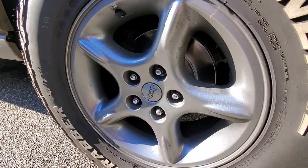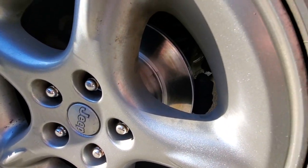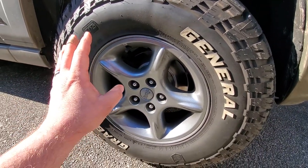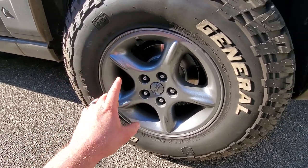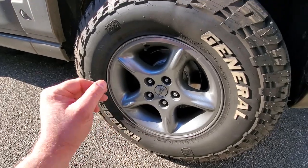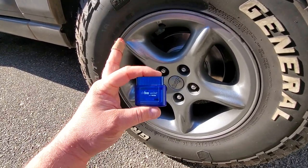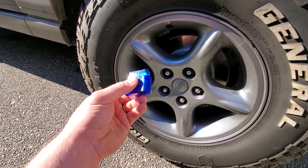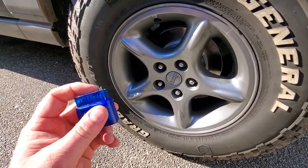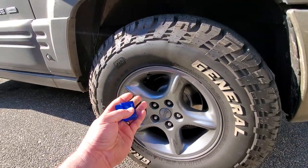All right guys, that was a successful braking process. Everything dried really nice — we got some nice coloration on these rotors, you can see the material has been transferred. That is a successful bedding process. It is normal for these things to get really hot, they might smell and may even smoke, but that's normal. Make sure you drive normally afterwards and let them cool down — park it for a while. One important thing: if you have a driving behavior tracker for your insurance discount, make sure you unplug it, because when you do some acceleration and hard stops they can tell and will ding you on your insurance. Pop it out before you do your braking procedure.